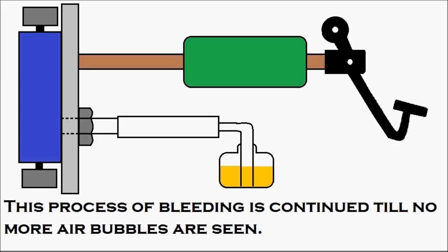You need to understand why brake bleeding has to be done. If your hydraulic brake is not efficient enough, air may have entered the system and needs to be bled out. The hydraulic brake system uses hydraulic oil, which is incompressible. According to Pascal's law, when pressure is applied on a confined liquid, the pressure is distributed equally in every direction — so as the brake unit is a closed unit filled with hydraulic oil, Pascal's law applies. But gradually air enters the system, and air is compressible. When you press the brake pedal, the air inside the system gets compressed, and the efficiency of the brake is lost. To avoid this, brake bleeding has to be done occasionally by opening up the bleed valve and following the procedure shown in the animation.